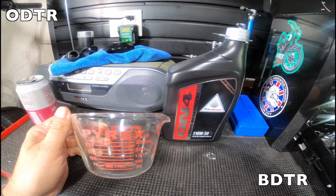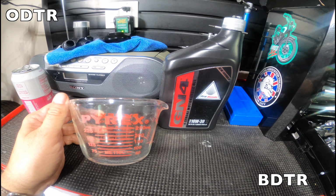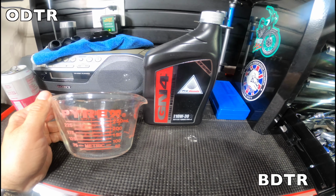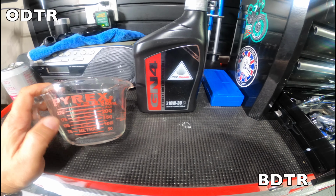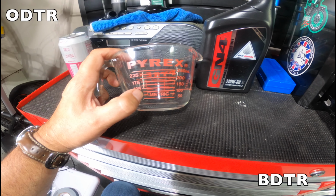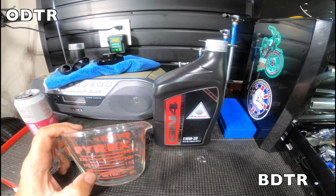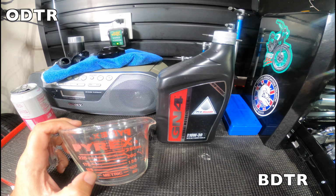Okay, the next part here of this 6-speed manual GL1800 Gold Wing Tour oil change is to remove 95 milliliters from one of the quart bottles. The bike holds 3.9 quarts of oil with an oil change. So I'm going to do that, and I've got an old measuring cup, and I'll fill it up to not to 100 here, but below that a tiny bit. And then I'll pour what's remaining in that bottle and the other 3 bottles into the bike after the new oil filter's on and the oil drain plug is secure.